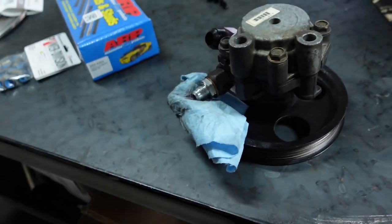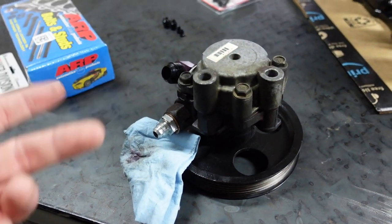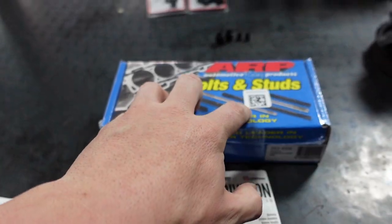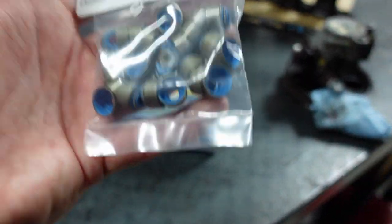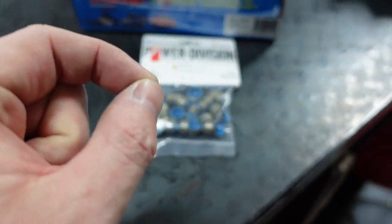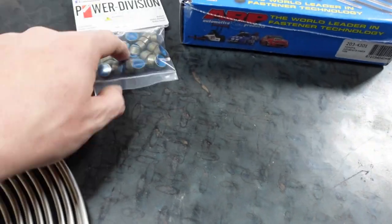I'm going to put this back up on the shelf. I've got a few other things to do: clean up the pump and spray it black. I did this on my wife's and it turned out really well. The pumps usually don't go bad on Supras as long as you keep fluid in them and don't run them dry. My CA 625 head studs came in — unlike the L19s, these can be touched with your bare hand, though I use gloves anyway. The L19s don't like oils from your hands. GSC valve stem seals — I've heard people complain about these, but my Supra, my wife's, and Tony Gagliatos all have these GSC valve stem seals and I've never had an issue. As long as you seat them properly and press them until you hear them click, I've never had a problem.